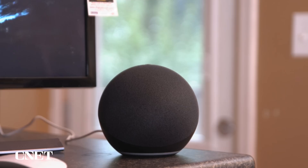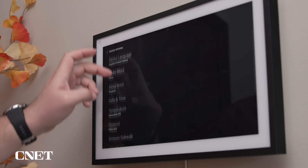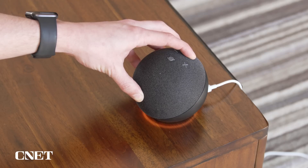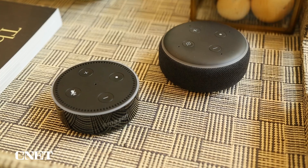The other thing you want to do with Amazon is give your smart speakers a factory reset. They're not necessarily going to cause you trouble unless you stuck them in a drawer for a while, and when you plug them back in they remember some of the old devices from the last time they connected. You can reset the smart displays from the settings menu on the device itself. For more recent smart speakers, you need to press and hold the action button for a solid 25 to 30 seconds. For first or second gen models, you want to hold the microphone off and volume down buttons at the same time. And our Amazon smart home is gone — bracingly empty after all these years.